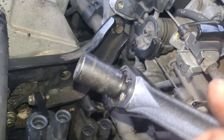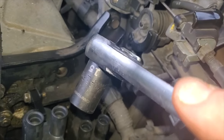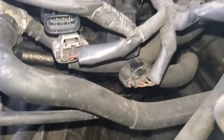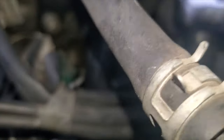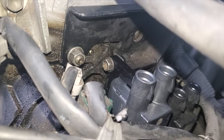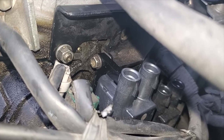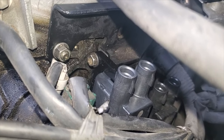This bolt back here, your 15mm — according to AutoZone, not a sponsor, that's what I chose to use to get some R&R info — it's 31 foot-pounds. These two hidden bolts down here: 15 foot-pounds. I believe this nut is also 12 or 15 foot-pounds as well. But the two 10mm bolts that hold on to each side of the coil — that's the 1 and 4 here, 2 and 3 in the back — those are 87 inch-pounds. Again, that's inch-pounds, 87 inch-pounds, not foot-pounds. Don't break anything.